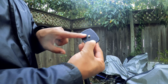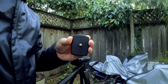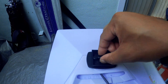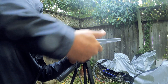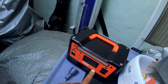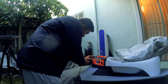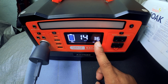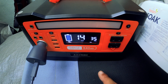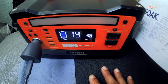What's cool about this tripod is I can actually take the quarter inch adapter right off the tripod and then screw it right on the back of the Starlink. Now all we got to do is plug it into a power source. I'm going to be using just a small little power bank right here, and I'm going to use the DC and show you guys how many watts it takes. As you guys can see, it's pulling about 36 watts right now — that is usually how much it takes when it's starting up. But once it gets going and warmed up, it usually drops down to about 25 to 30.